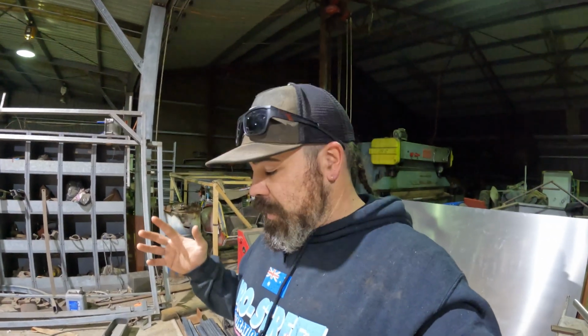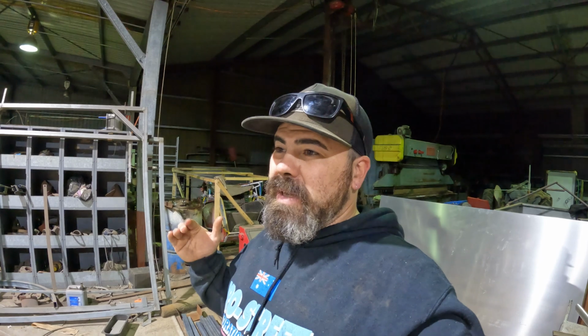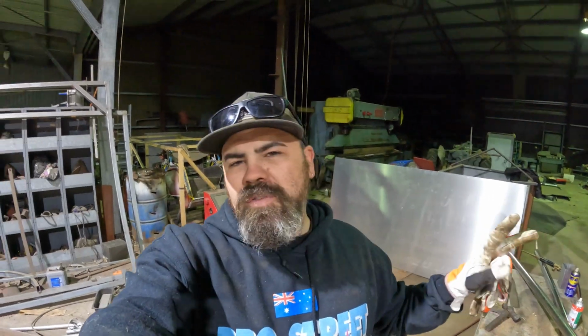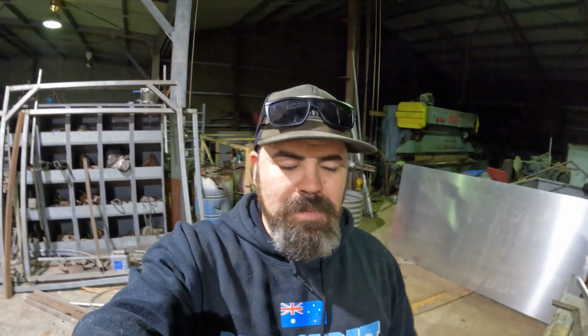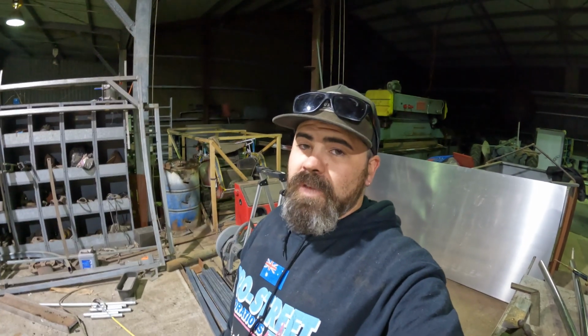I'm gonna lower the original springs the old school way of doing this, using an OXY. We're gonna bring it down, hopefully, another couple of inches. This may be a little bit low, but look, it just gives us something to go off. I don't want to fuck around with the lowered springs because the missus is driving it nearly every day. I don't want to have it off the road too much, but it might get to the stage where I've got to pull them lowered springs out and send them in to be professionally done.